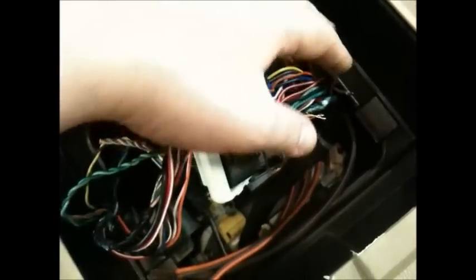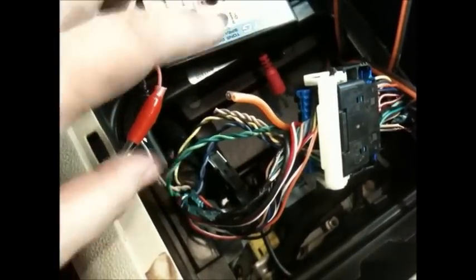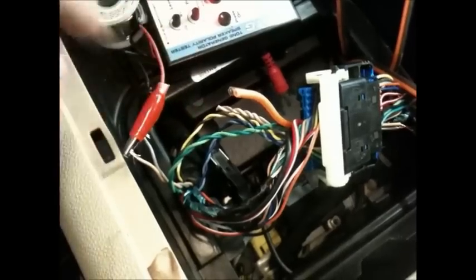Right here's the wiring. You can see over here, I'm going to reconnect these guys, but the reason I didn't use this side to tap for all the bypass, and right here's all my wiring already as well, that we're going to run to the amplifier. Here's the other one right here. The reason I didn't use this is because you see how this is another connector here? You want to eliminate as many connectors as you can. You just want your wiring directly to the speaker, eliminating any type of resistance. Even though it's a metal contact, it's not as pure as copper. Usually this is never copper. This is some type of aluminum or a blend of aluminum and copper. That's why I'm not going to use this. I want a straight shot to my speakers and give it the most audiophile sound I can give it. So that's how you do it. It's on this side, not this side of the connector. It's on this side for the speakers.